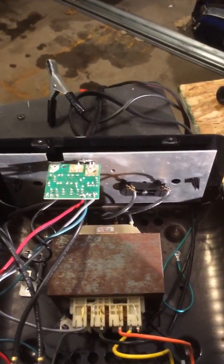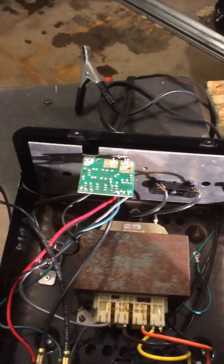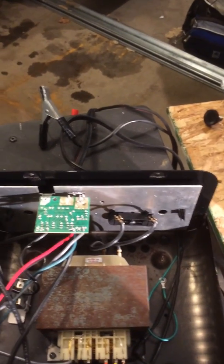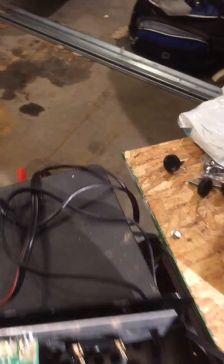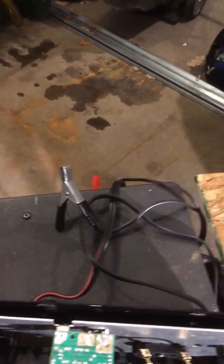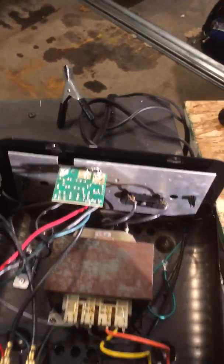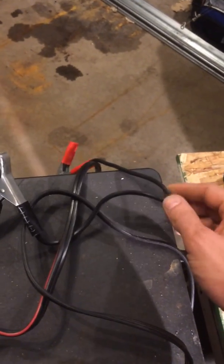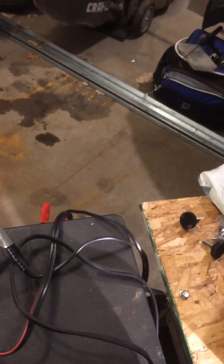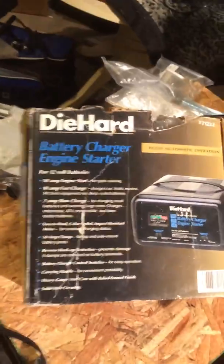After you do all these changes — like unplugging the wire — don't just leave it dangling out there, it'll arc. Don't just cut it off. You could still run into problems if you're trying to charge on 10 amps for a while — you're probably going to feel warmth in the wire as it heats up because of a high amp draw, because it's too fine of a wire. You could put heavier wire through it — I'd suggest it, that'd be a good idea. It's not like you use this thing every day anyway, it'll probably work fine. But the biggest problem is the wire inside here just isn't heavy enough gauge. If they would have put heavier gauge wire, you probably wouldn't have had that problem. Thank you very much. Good luck.